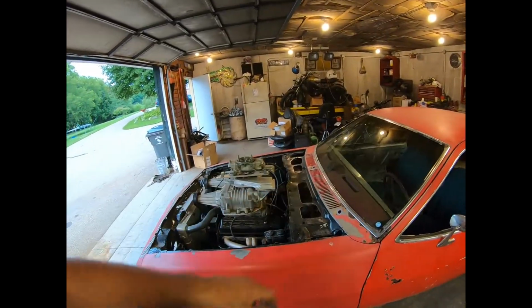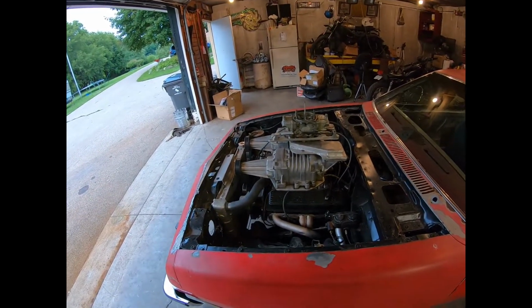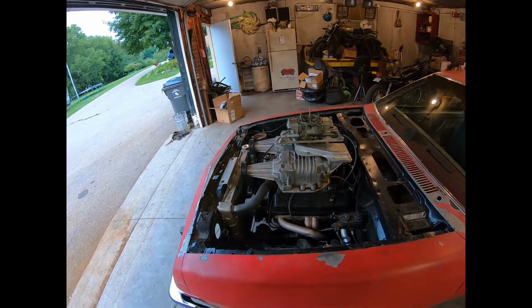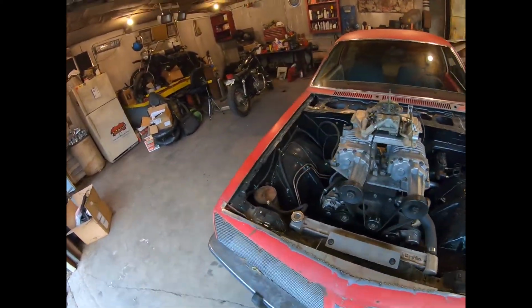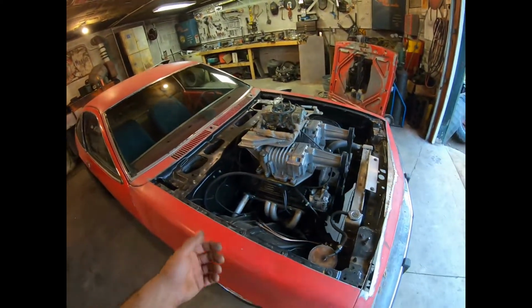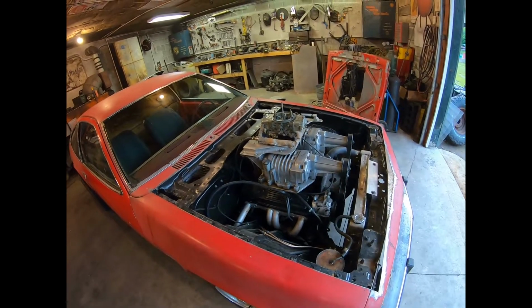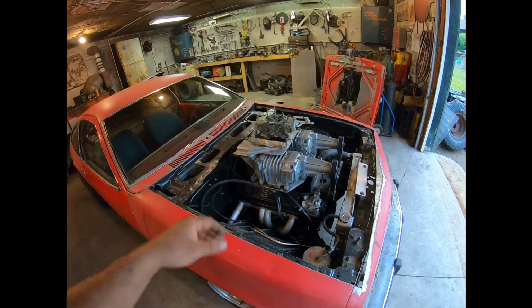All right, so other than the carburetor and the air fuel gauge, I did actually go through the entire bottom end of the engine. It is all brand new underneath. I still have the swirl port head sitting on top. They were redone. There's a little bit better valve springs on them. I put the same cam in the bottom end that was in it before, just a 480 lift cam, just a white box Chinese cam, but I kind of like them, so that went back in.